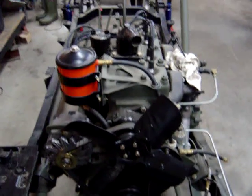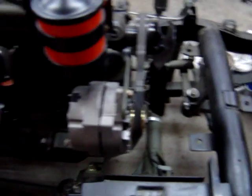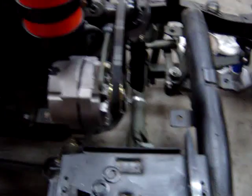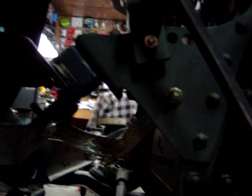There's the engine. I guess the next component for the engine would be the carburetor — I've got a rag put in there now. The only thing that's not going to be original is the electrical system. I decided to go with a 12-volt upgrade, which includes an alternator instead of a generator. You can see here I've got a bracket made up that goes down there, and I made up a bracket down below for where the old generator mount used to be.